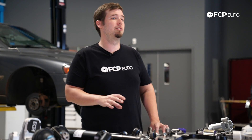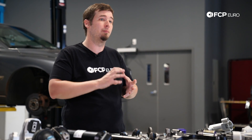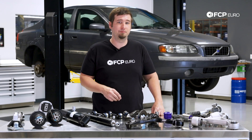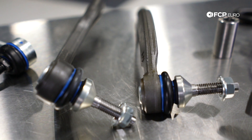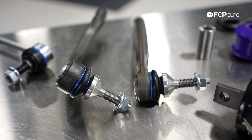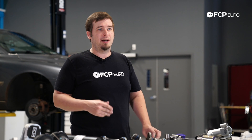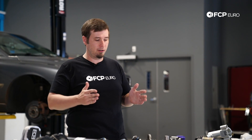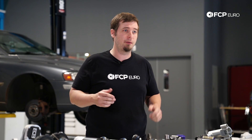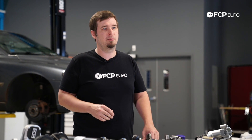There is another problem that sounds very similar to a ball joint popping — that's called axle ping, which is caused by the axle splines actually shifting and binding in the hub. I go a bit more in depth on that in the drivetrain video linked below. Another thing to be mindful of are the tie rods, which also feature a ball joint that wears out. These are your direct connection from the steering rack to the wheels, so you really do not want one of these to let go. When the tie rods are bad, you'll notice a torn boot usually, as well as wonky steering feel. When the tie rods are loose, it will cause the car to pull one way when accelerating and pull another way while braking, because as the wheels compress and unload, the steering angle will actually change a little bit. If this is happening, definitely figure out what the problem is immediately.